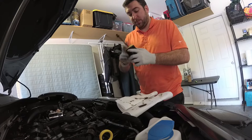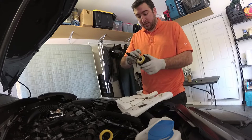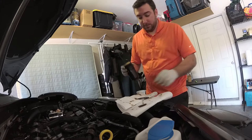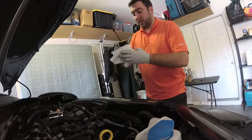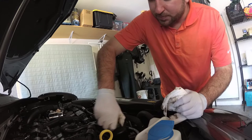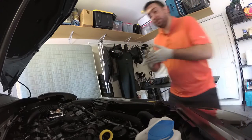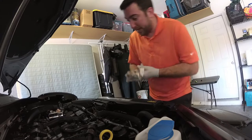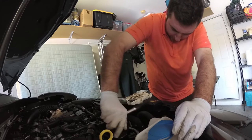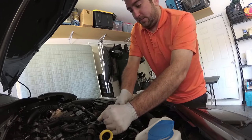We've got the oil filter out and we're going to put the new one in. Slide it down until it clicks and we're going to go ahead and change out the rubber o-ring. Clean up the case a little bit, install it back — simply slide it down. Make sure all the threads are lined up before you start putting pressure on it. It's plastic on metal so you can tear those threads up pretty easily. Just hand tighten it until you are sure it is tightened on, then give it a little more — not too much pressure.